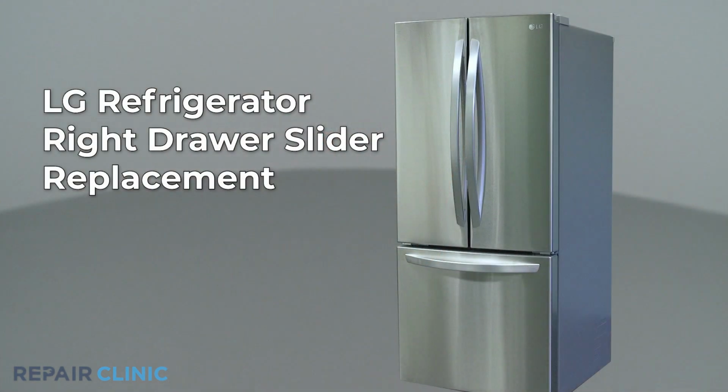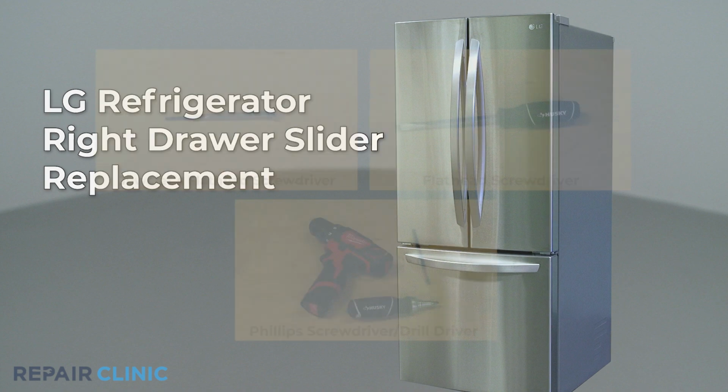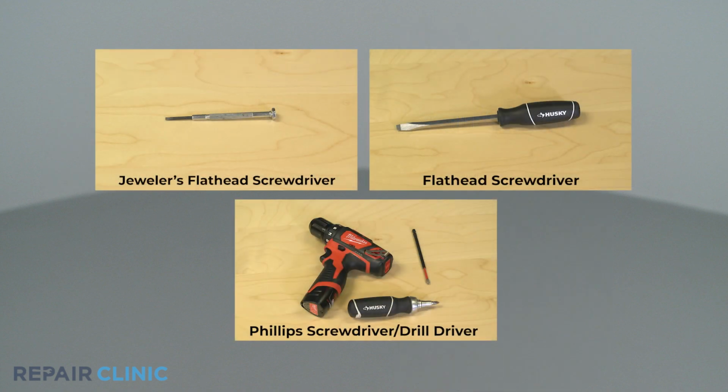Whether your repair is simple or complex, you'll be more successful if you break the procedure down into steps, making it more manageable. I'll take you through this part replacement repair one step at a time. To replace the right drawer slider in this LG refrigerator, you will need a flathead jeweler screwdriver, a flathead screwdriver, and a Phillips screwdriver or drill driver with a number 2 Phillips bit.